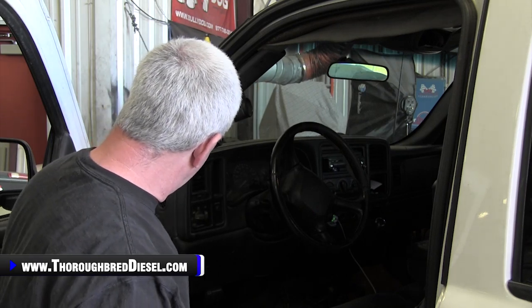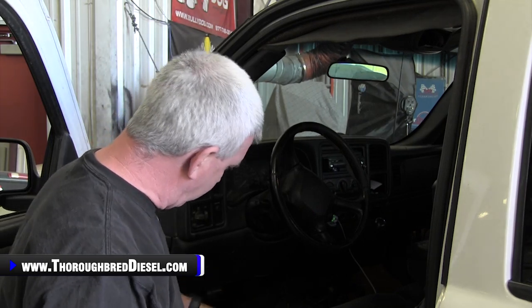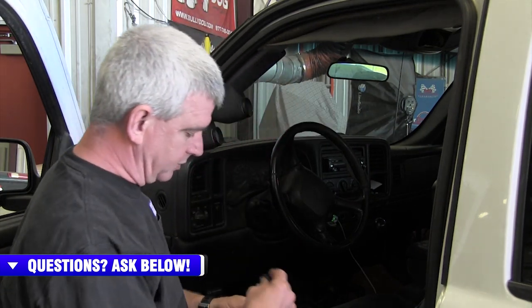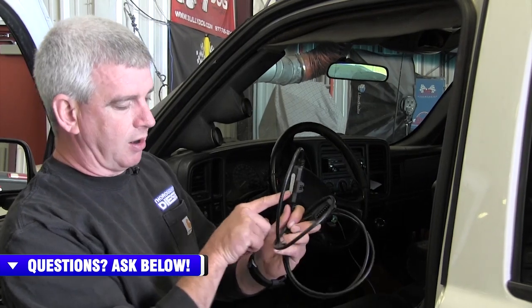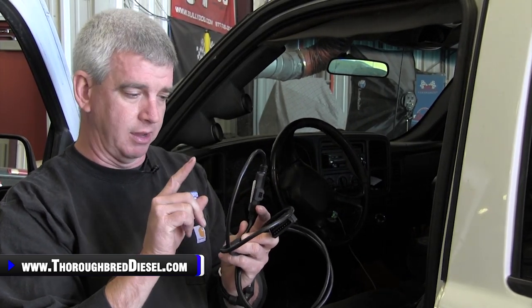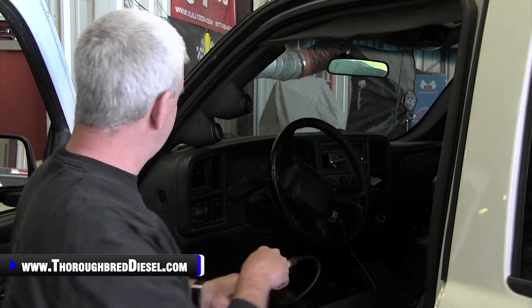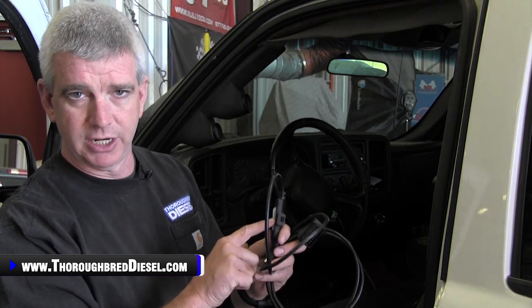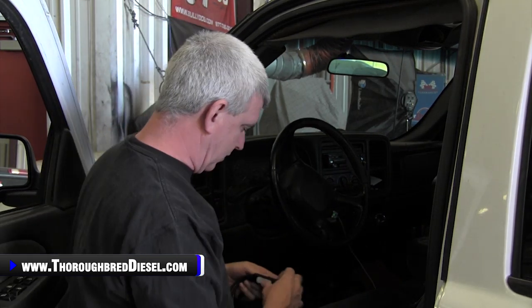Most trucks, your wire is going to come through here, down to your OBD2 port, tuck it away real nice and neat, and then put your Insight on the windshield. If you saw this cord and this little expansion port on the HDMI cord, this is your port for your incoming EAS sensor. Your EAS daisy chain will be out underneath the hood for whatever expansion sensors you hook up, and this is its inbound signal coming into the Insight. So let's go ahead and hook everything up.